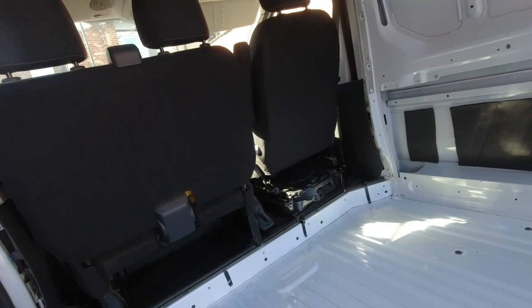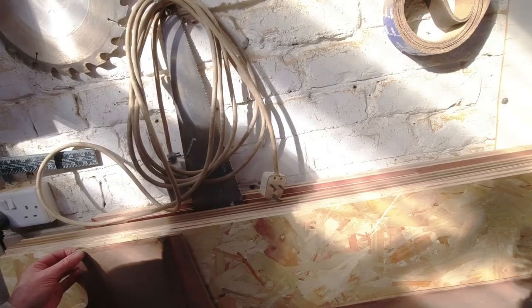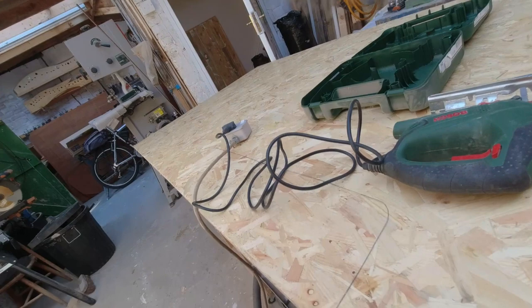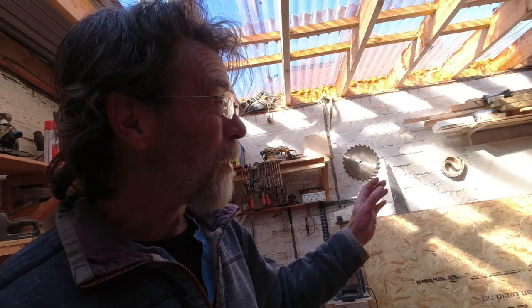All marked up so we know where we're putting the screw holes. Back in the workshop, here we have the old template of the floor — looks like 9mm ply which came out of it — and we're going to replace that with this new 11mm OSB. First things first, we're going to cut that to shape. It's all marked out from the old floor template and I've got my jigsaw ready with a fresh blade in. We're just going to cut these patches out.